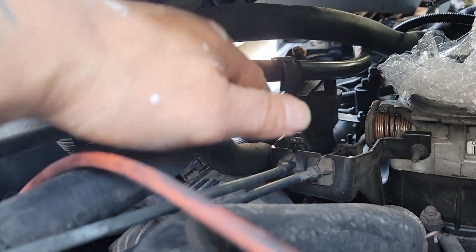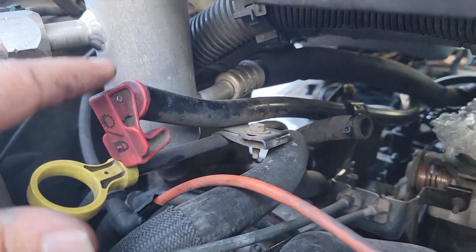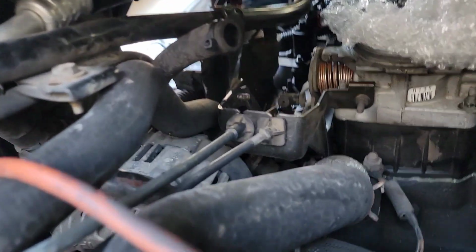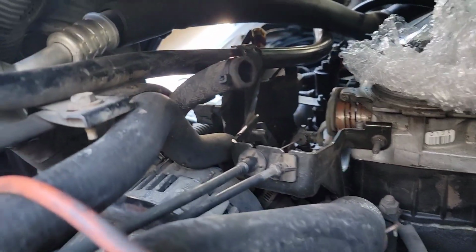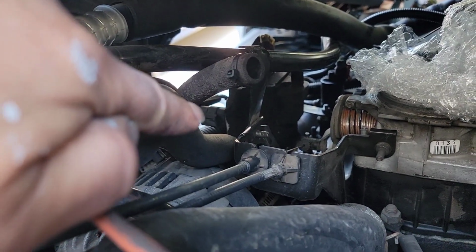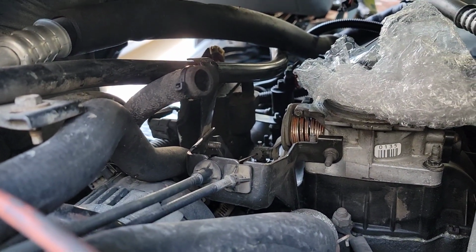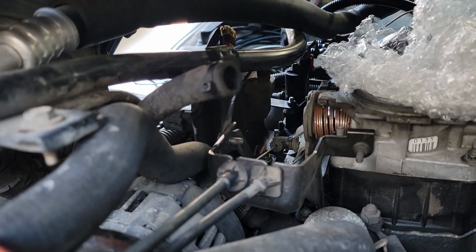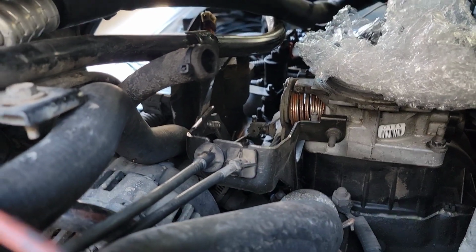One of the things that makes this a little bit more difficult is the extra bracket that holds the tube for the oil check, filler tube. That's actually attached to the throttle cable bracket. So a little bit of a hassle, and I got to get in the front here with a screwdriver. I think I'm pointing at it right now to get the plug off of that ICM. So it's just tedious stuff, but there's a few bolts to hold this bracket in place. That comes off. Then there's two bolts on the manifold up there that hold the bracket for the ICM and coil on.